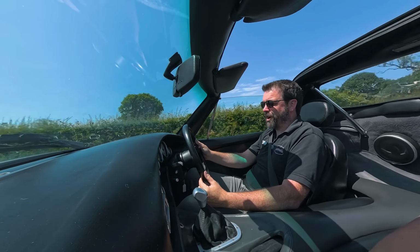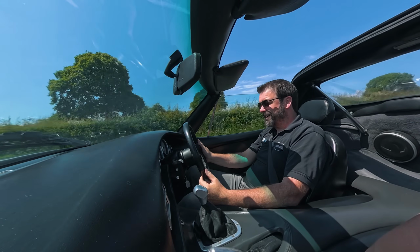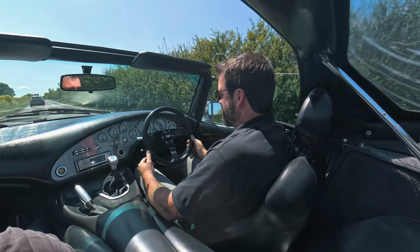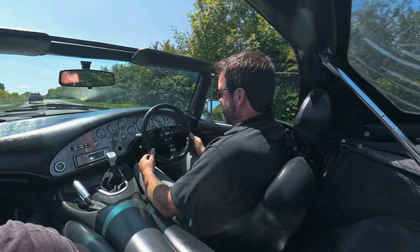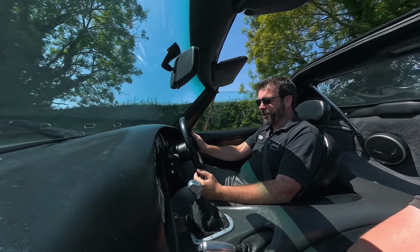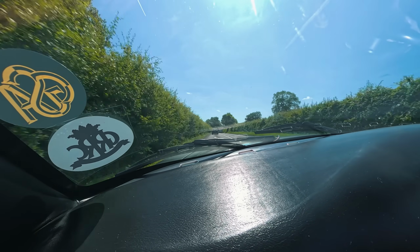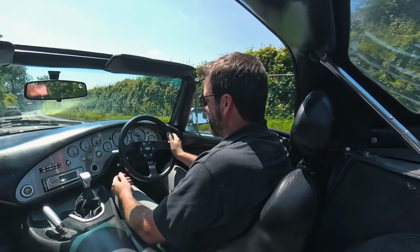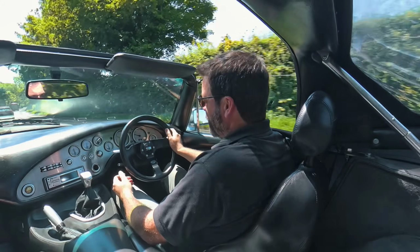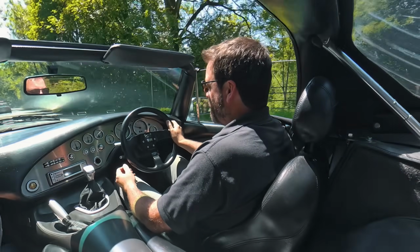The first thing you notice about driving one is just how precise they are and how easy it is to steer and point where you want it to go, and you're not constantly fighting with the steering to keep it in a straight line and over bumps and cambers in the road. And if you compared it with a standard car, you'd feel how different the chassis is in terms of stiffness, torsional stiffness. Again, that's one of the first things we concentrated on, making the chassis so much stiffer, because all the upgrades and developments you do on suspension don't mean anything if you've got a floppy chassis.